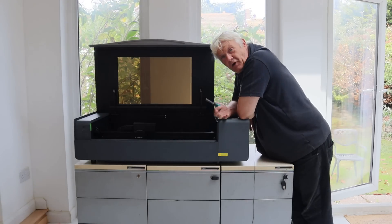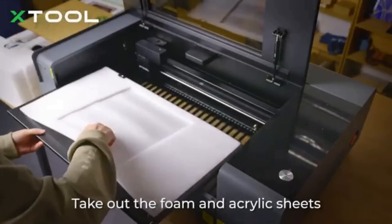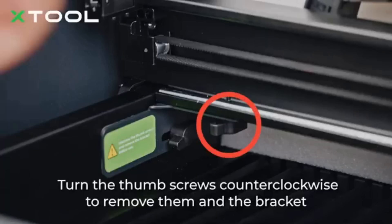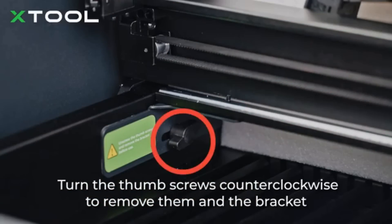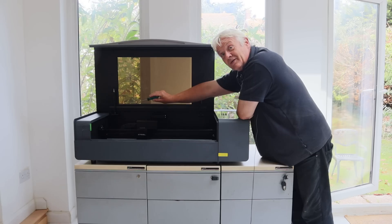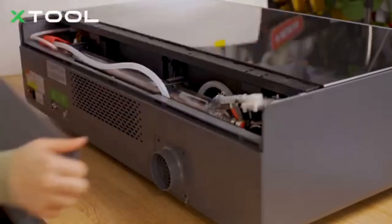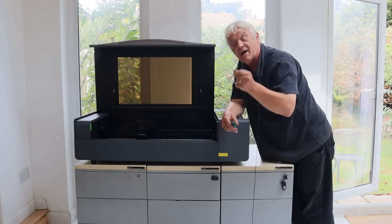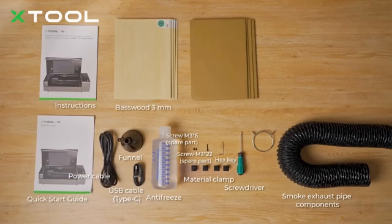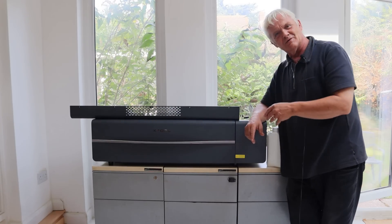The setup of the machine is easy enough, if a little awkward. There's a screw at the bottom that you undo to pull out this drawer, remove the packaging material, slide it back in, and screw it back in. That screw is a little bit awkward to line up. Then, on this here, for transportation there are a couple of wing nuts either side you need to undo and remove the restraining bolts. Then you have six screws at the back with a little tab to remove, and four at the back giving you access to the tube. This was quite firmly attached — I had to persuade it loose with the edge of the screwdriver even though I'd taken the nuts out, so I was a little bit worried about that.